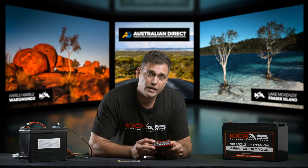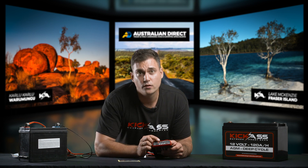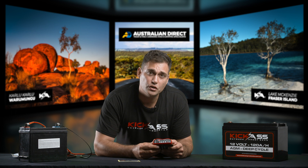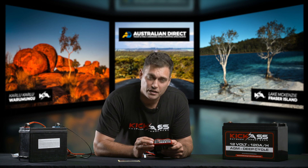If you've already connected your start battery to the DC-DC charger and you see that all of the lights are flashing, that's a no auxiliary battery connected fault. Disconnect the DC-DC charger from the start battery, get the auxiliary battery connected, then connect it back up to the start battery, and I'll run through some of the common fault codes and lights and what they mean.